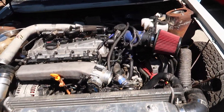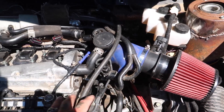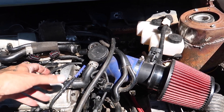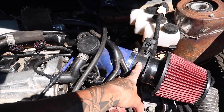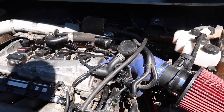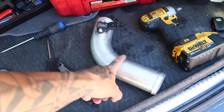It's a new day. I had to rob the MAF and the MAF housing off of the 24 valve, because the 180/225 engine takes a MK4 VR6 12 valve, MK4 24 valve, or Audi TT one. I don't have the 225 so I'm just using that one. Went to the junkyard this morning and couldn't find one, so I have my boost pipe with my boost sensor bung attached and that's set up ready.